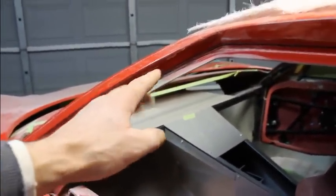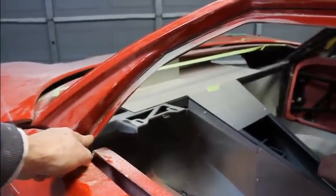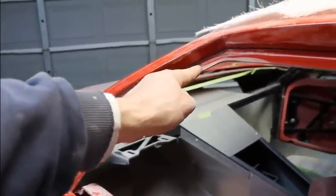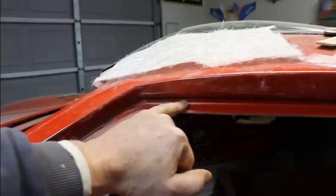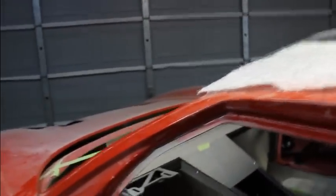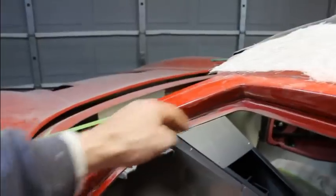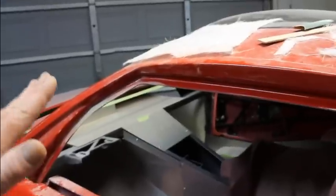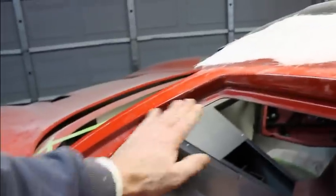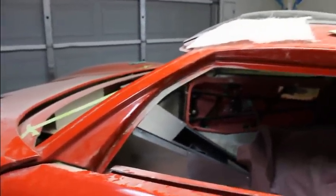And then after I sliced that, I put the glass on there and let that bend in, and I drew a second line and it's down tight all the way. There's a little bit of a gap down in here, which I'll probably bring up just a touch. And then I'll grind that down and glass it from the back, and then do it again from the top. That way I'll be starting from a nice level, contoured fit to the glass, so I won't be fighting that this time. So that should save me a whole bunch of days compared to last time when I did it.